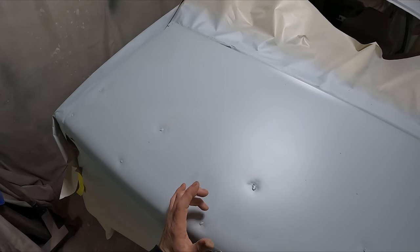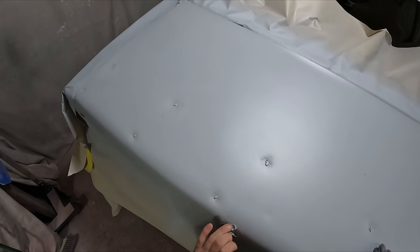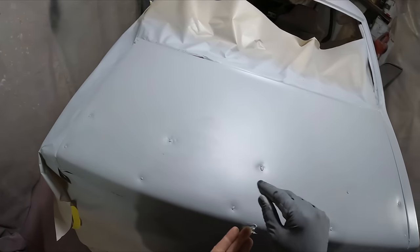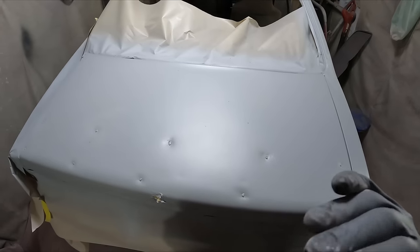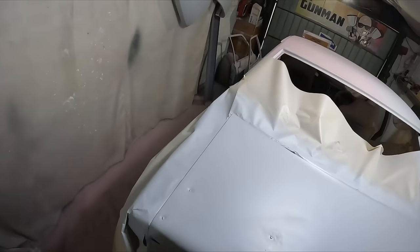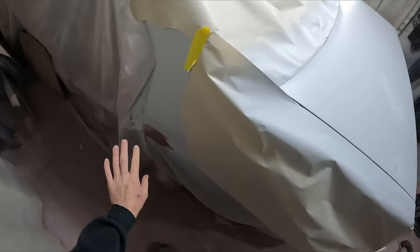There is actually an advantage to getting onto it early. This epoxy primer seems to take a fair while to actually dry, so it's still kind of sticky as you can see. I can still kind of dig into it. What that means is that if I go and put my body filler straight onto it now, it's going to bite right in — it's kind of like putting another coat of primer on when it's just flashed off. I've done some tests over here without even sanding it and it is sticking really well.